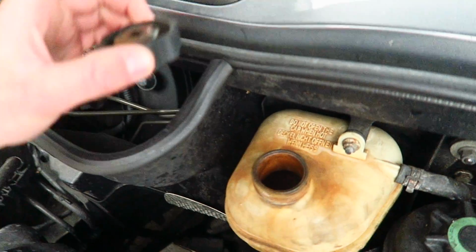But I did lose 1 litre, and 1 litre would be a lot if it just needed bleeding. But as I say, I've been driving it for about half an hour this morning and it's actually lost nothing. So, don't know, we're going to get the head tester. But then again, if it is, we're going to be changing a head gasket, which would be quite fun for us to do. Right, take your bids.